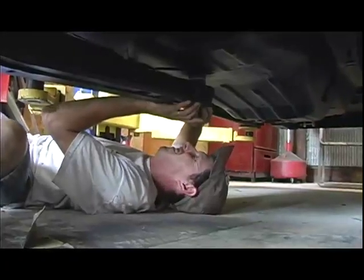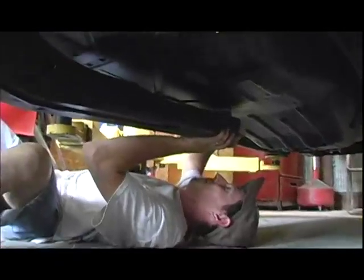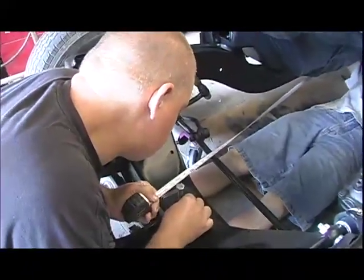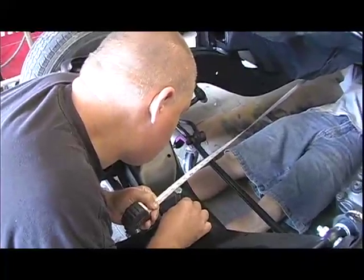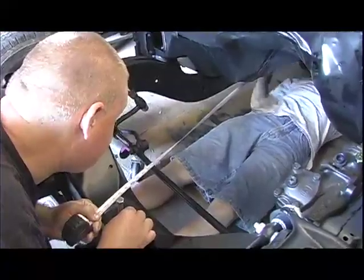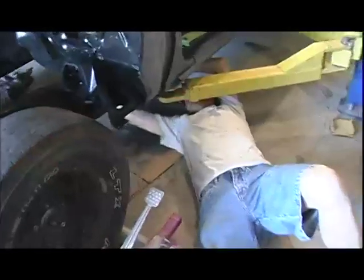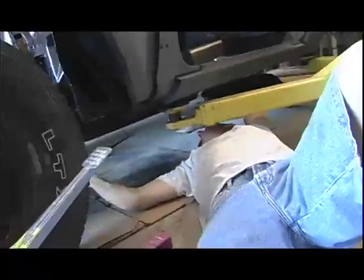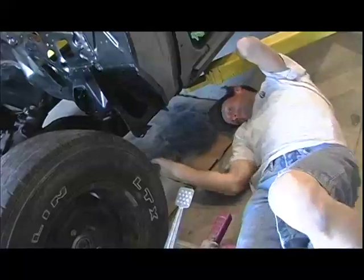And then to make sure that the whole thing is lined up properly, there's another guide hole in the front cross member where the engine goes, and we use the old-fashioned technique of tape measure and stringing it out to measure left to right to make sure that this thing was perfectly square with the body. So now we'll have a nice solid foundation to make sure that all the sheet metal fits properly when we get to that stage. Then we went underneath and properly torqued all those subframe bolts, because the proper torque setting will crush the bushings the right amount and everything will fit right.